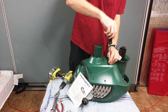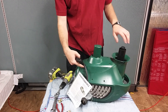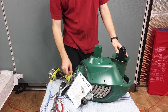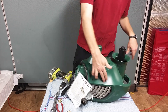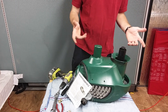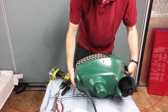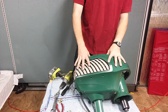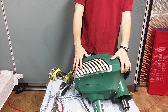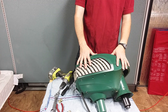You also don't want to torque these screws down too much — I have seen the brass nut plates in the plastic below crack out if you torque those down too much. Similarly with the screws on the side: they're just screwing into plastic, so don't screw them in too tight. There you go! Simple, pretty simple fix with common tools. Get in there, replace your fuel nozzle, and be back in service.